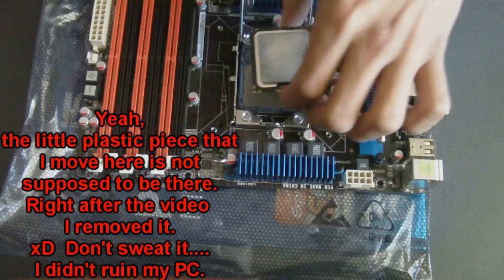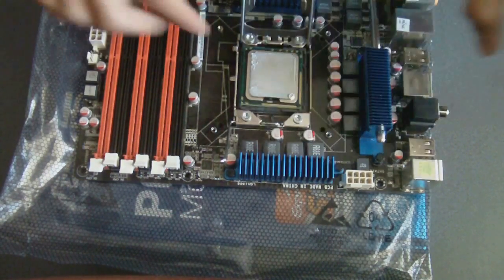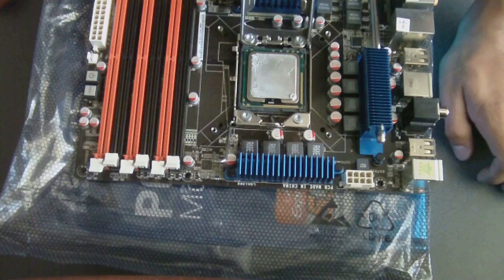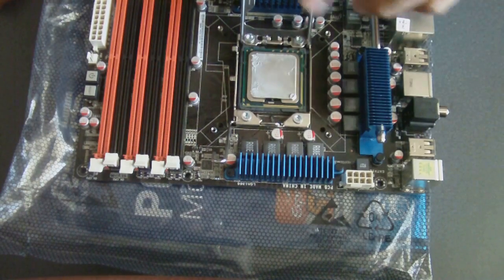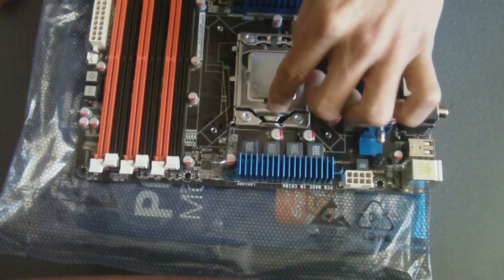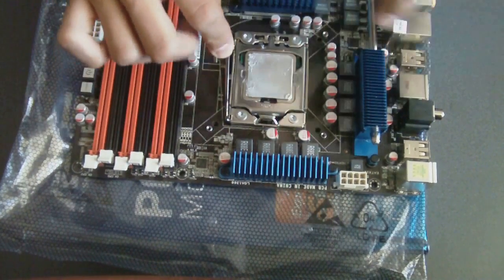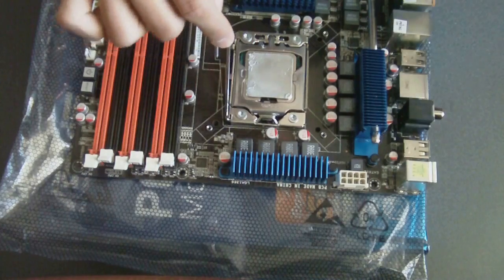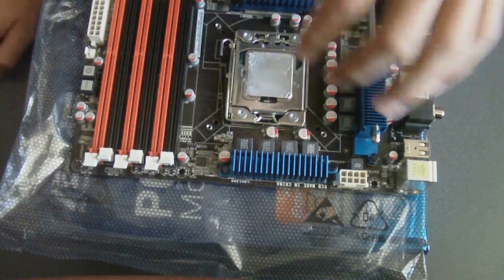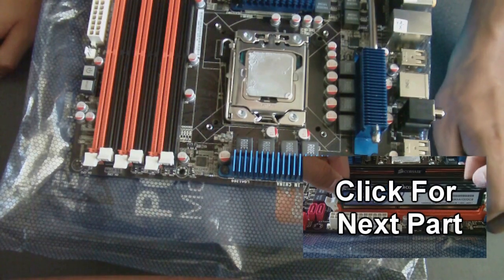So be kind of careful when putting this in. Then you just drop it in there — like that. Just drop it in there. Don't apply any pressure, don't press it down or anything. Then you're going to close this door. Another tip: don't touch the thermal paste. And then you're just going to close the door right there. There might be a lot of pressure — there was just a lot of pressure right there. So there you go, now you have the CPU installed.